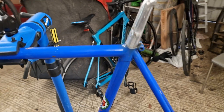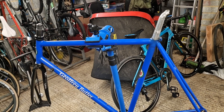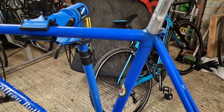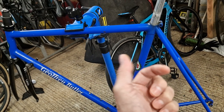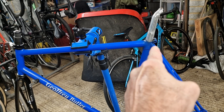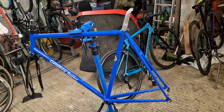So what I'm going to do now is something I've never tried before - I am going to try sodium hydroxide, or better known as caustic soda, or lye. Because apparently, this being steel, I can tip the frame upside down, pour the sodium hydroxide solution into the seat tube, it won't affect the steel - but it will eat the aluminium. It's not going to be immediate, it'll take time, but I think that's the only way I'm going to get this thing out.